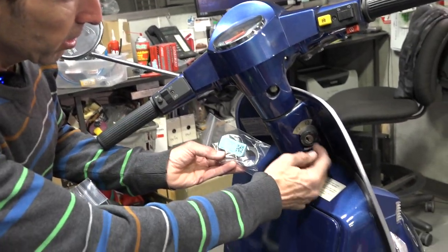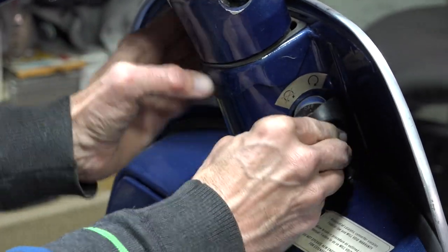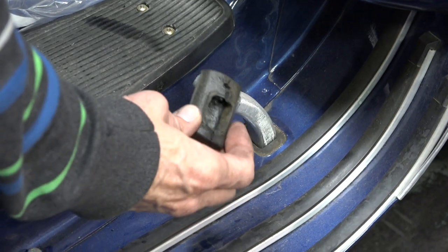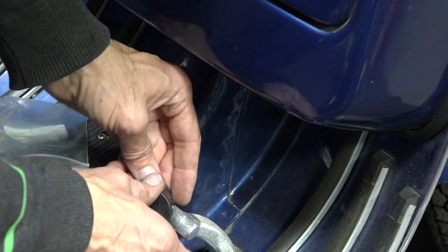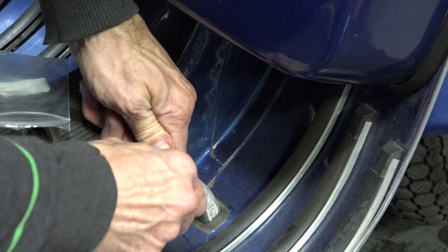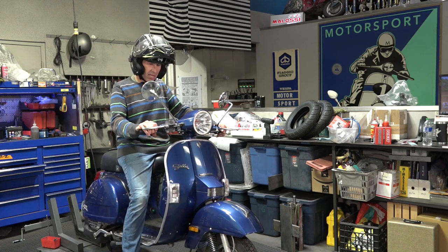You can see this rubber surround around the ignition lock is completely rotted - part number 178563, not much left of that. Sometimes you're better off putting these rubber parts in boiling water to heat them up before fitting. Moving down to the brake pedal - it's pretty crispy as well. The replacement is the original-style waffle brake pedal, part number 182051, an original Italian Ariete brand so it's good quality. Work it over the brake pedal - much better than that dried-out original. Thanks for watching - this is the first part of some refurbishment to the Ameravespa 2023 raffle scooter.